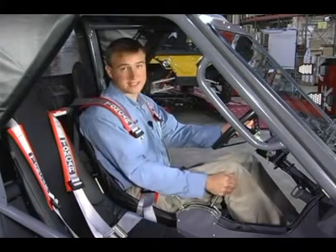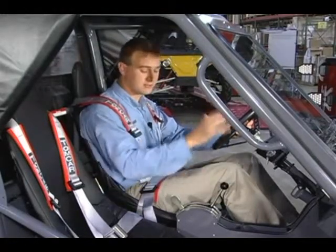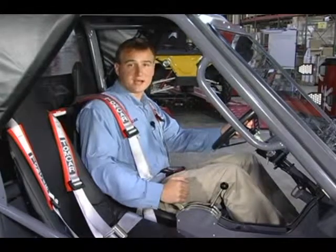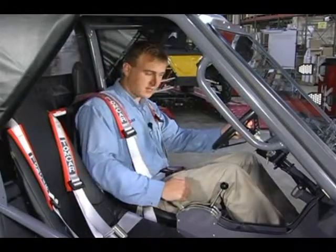We'll talk a little bit about gear selection here. If I was just taking off on flat ground, high gear is the right choice. If I'm stopped at the base of a hill ready to go up something really steep, then I'd want to shift it down into low. The on-the-fly lockable differential — I can choose as I get going and start to lose traction whether I need to engage that or not, so initially for taking off, I'm going to leave that off.